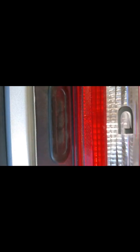Okay, and a heads up. There's another screw that separates this piece. I've been pulling on it, kind of messing it up. Glad I saw that. If you look right here, this piece, the button, it shouldn't be like that. You've got to separate those two pieces in between right there. I don't know if you can even see that. And there's clips on top of that, and there's these screws right here. It's just a regular Phillips screw. Loosen that and it should separate it. There's one on the other side also.